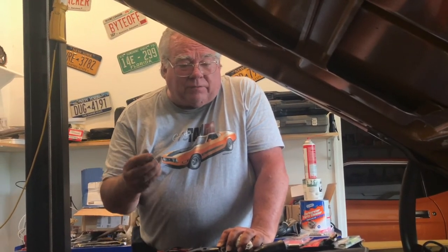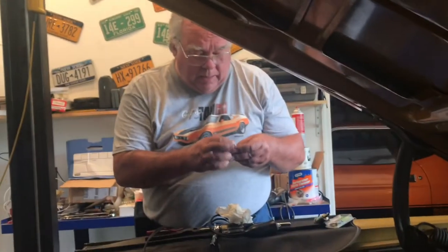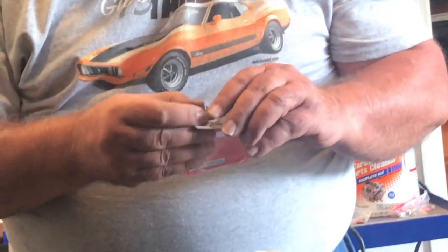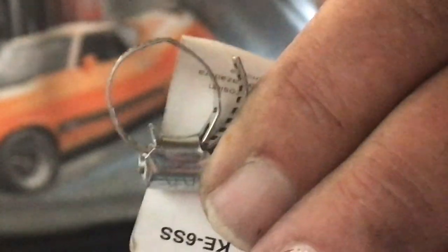So I took the clamps off to see what the saddle looked like. And if you take a look at this one, I'm gonna put it up against the white background. On the one side of the saddle inside, you'll see some of the clamp strap. I'm going to point to it. The clamp strap is bent almost 90 degrees. Right. And that would have been inside sticking up. The clamp surface into the outside diameter of the rubber hose.